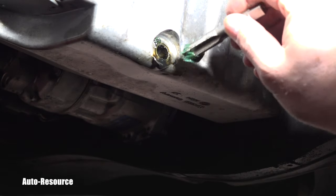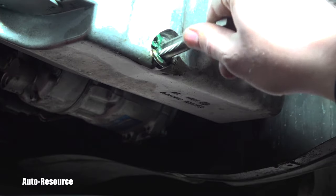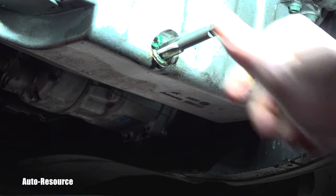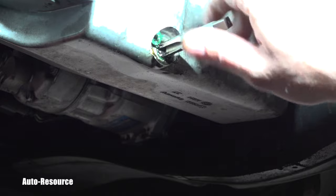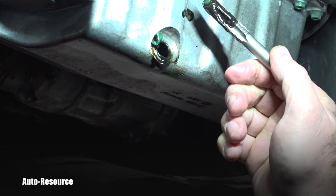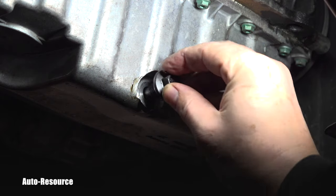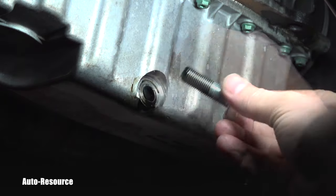The dripping oil is a problem while working underneath, but I have to deal with it. This is getting better and better. I'll grab the tap again and continue cutting carefully — still almost no resistance going deeper. Second pass done. I cleaned off the grease and shavings. Testing the new M14x1.5 bolt — it still has noticeable play, wiggling around in there.